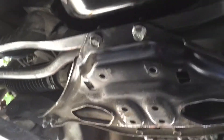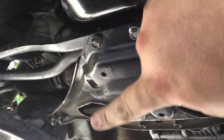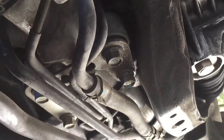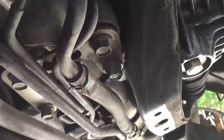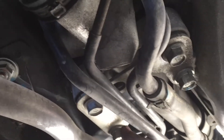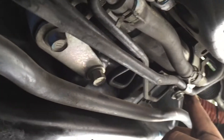We're going to be taking this bracket off — you got 12mm bolts, those look like 14s or 15s. There's two on this side right there. Once you get that bracket off for the rack and pinion, this is what it looks like. You have this is one of the braces here — Cusco makes a thicker one. Taking that off, there's also a mount here, we're going to be changing that bushing.